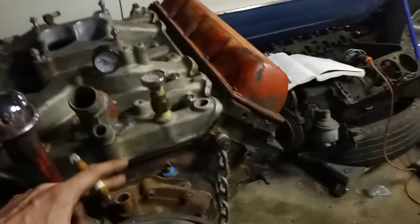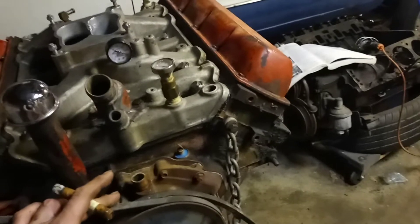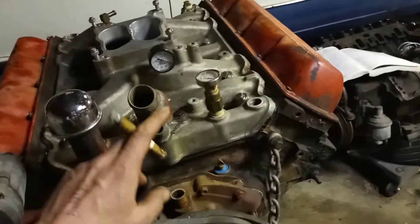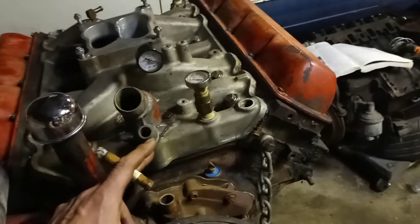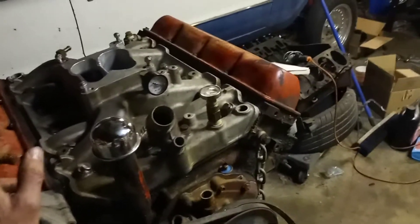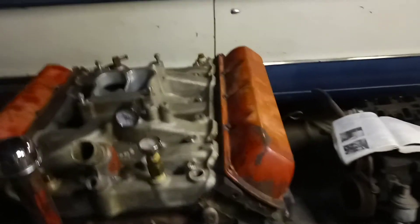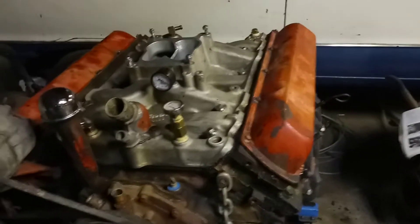The manifolds are on. I'm going to plug the bypass and the heater — just cap everything off — so the water pump doesn't deadhead. What I did is took a 160 thermostat and drilled six holes in it, probably close to 3/16. It'll get all the air out right away and always have some flow, so the pump won't be fighting against deadheading. It'll work.